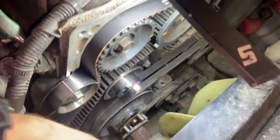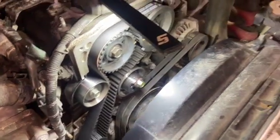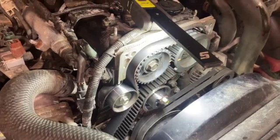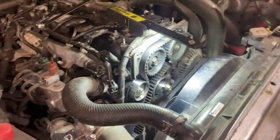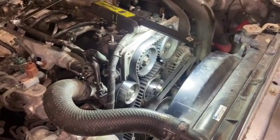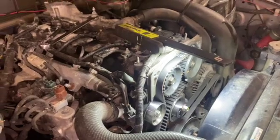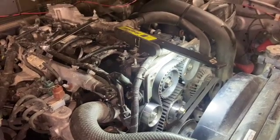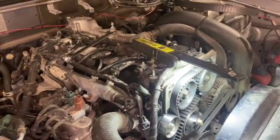Now we're going to bolt the viscous fan back up with the four bolts and nip them up. You can start the engine without the cover on if you want just to check it, but there's no need — we'll just build it all back up and then start it up to make sure it sounds all right. The cam belt is all done. It's a quite straightforward job on these. Because it's only a top-end belt, if the belt does snap it will break the rockers on these engines. I hope the video helped — give it a thumbs up and subscribe to the channel.